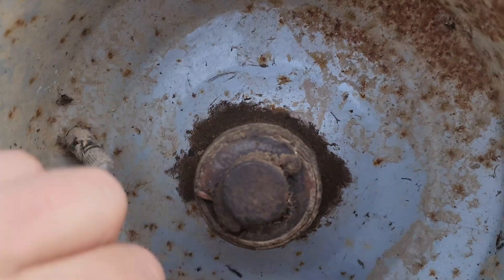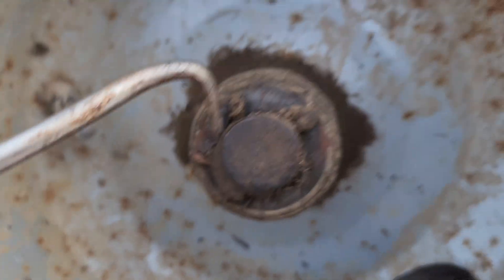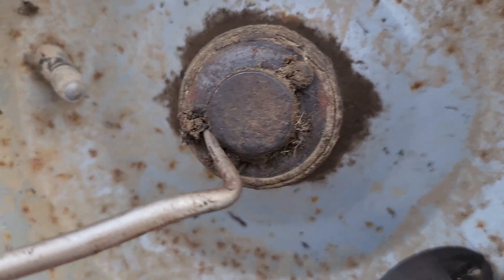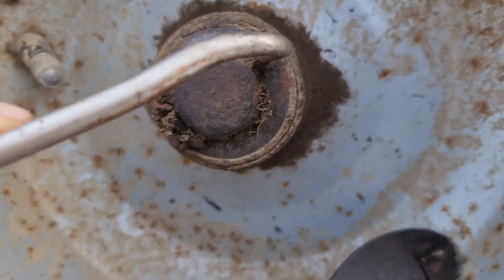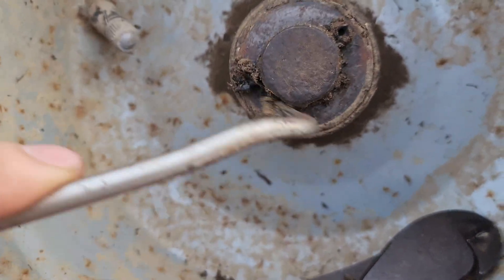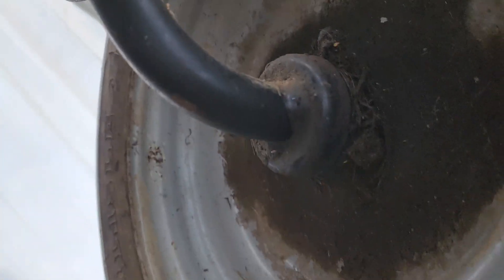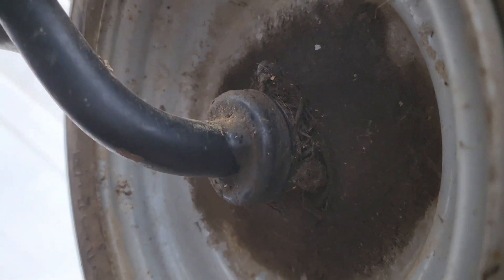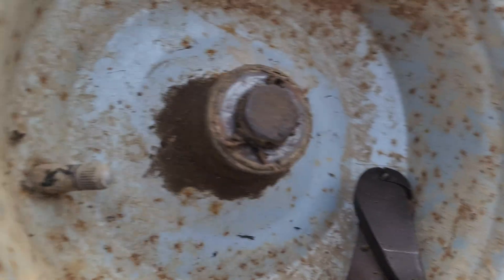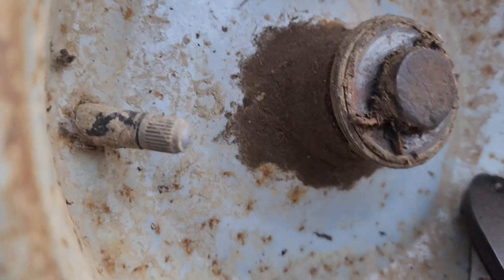For these front wheels I just have a little cotter pin which is kind of sunk in there. Usually these get packed full of debris, dirt, and grass, but luckily on this one they seem to have taken pretty decent care of it, because there are grease fittings for the steering and for the back of the front spindle, and it looks like they kept on top of that. That will save some headache getting these off.